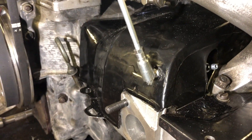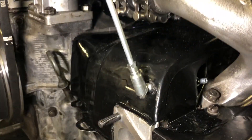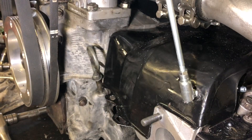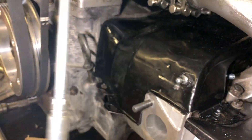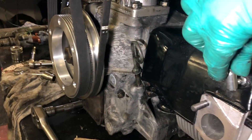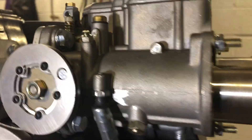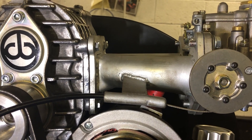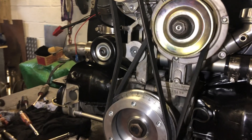M6 ball joint at the bottom. This is a sleeve joint, so I can just lift that up. I have to loosen this off because it is taking strain. That just pulls off like that and it unbolts at the top. What that does is give that little bit more support for the carburetor on the manifold, so that over rough ground all the tensions here don't change.